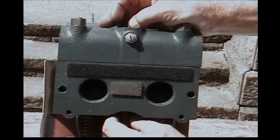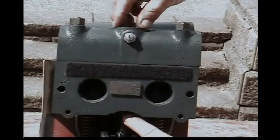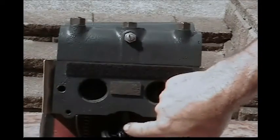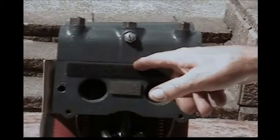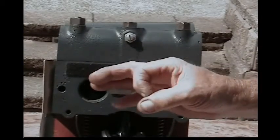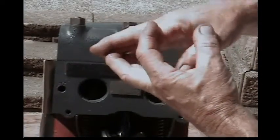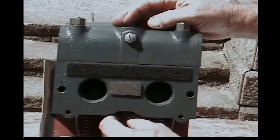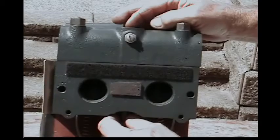Rotate it until it falls in, just like that. The shaft goes down through a tunnel from the distributor point all the way down to the device. In that tunnel, there's a head gasket. You want to make sure that your head gasket hole is the proper size — it should be the entire opening of that orifice to give this shaft plenty of room so it doesn't rub on a piece of head gasket and interfere with the function of the automatic advance.